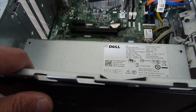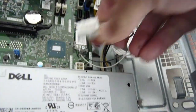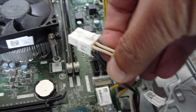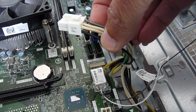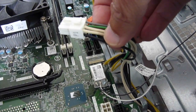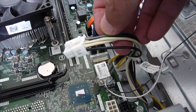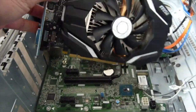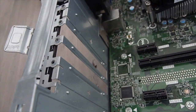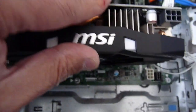This Dell has a very small power supply and doesn't seem to have enough power, so we have to change it. The six-pin supply connector has two white wires for 12 volts, gray and green for the PS_ON and Power Good signals — same as in a 24-pin connector — and two black wires for ground. Remove two of the tabs and push the module down into the slot.